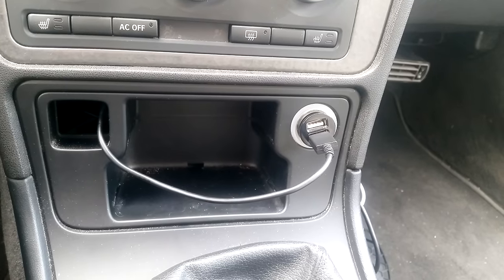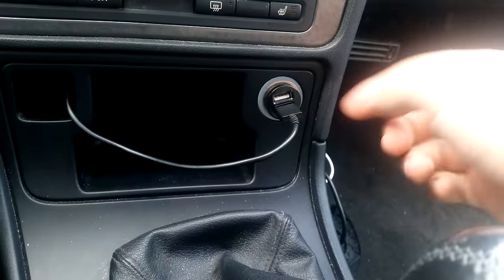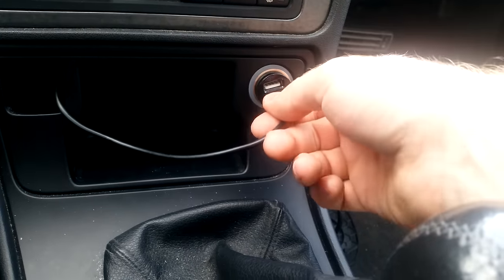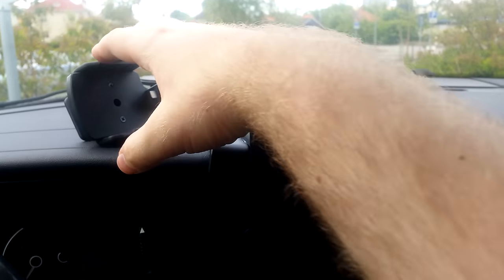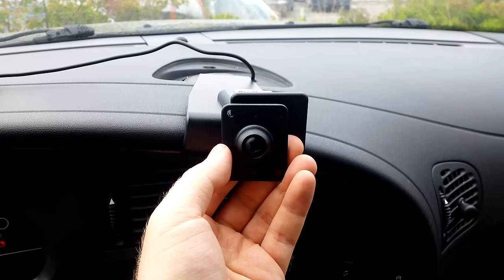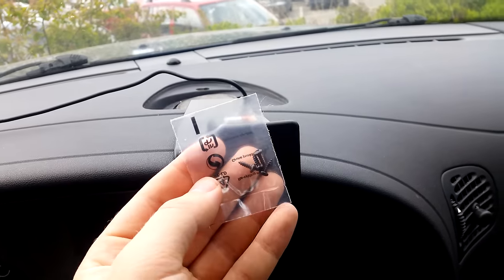So here is the quick and dirty version. I pushed out the little blind plug here and I routed the cable through. You might be able to do something else like route the cable from some hole here, but I decided just to do the quick and easy route today. What remains now is just to put the speaker back, put the screws in, and then attach the phone holder to the mounting bracket. To attach the phone holder to the mounting bracket, you will use the small screws that came with the phone holder.